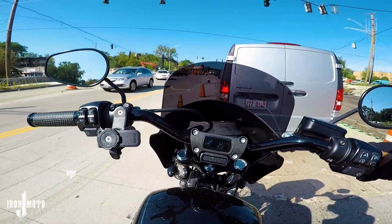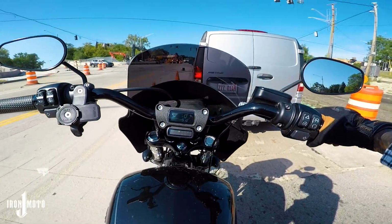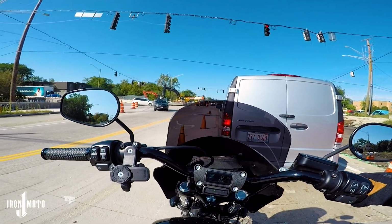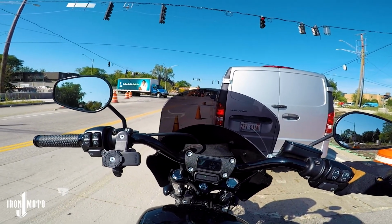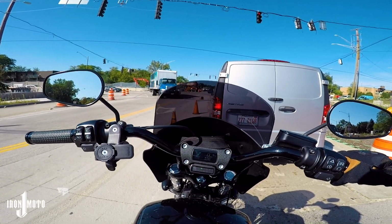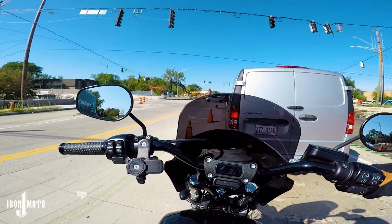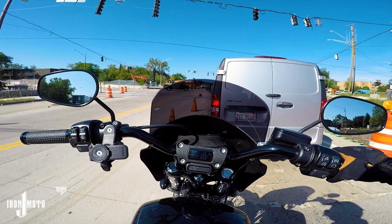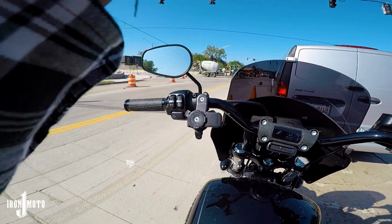And then you can talk about 2-to-1 exhaust. Most club style bikes are going to have a 2-to-1 setup. Doesn't always have to be. You get a lot more performance. Sure, they're not as loud as a 2-to-2, but you get more performance out of a 2-to-1 exhaust. Bassani, Vance & Hines, Cobra, some of the higher end brands, HPI, Thrashin, D&D.